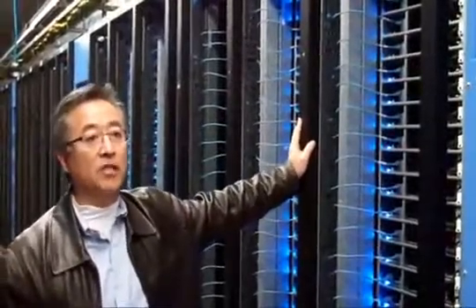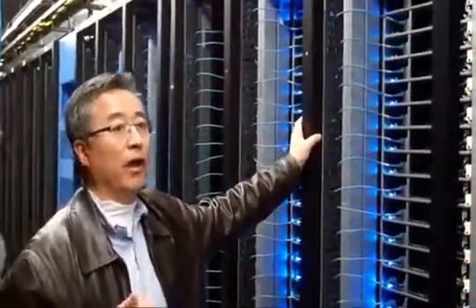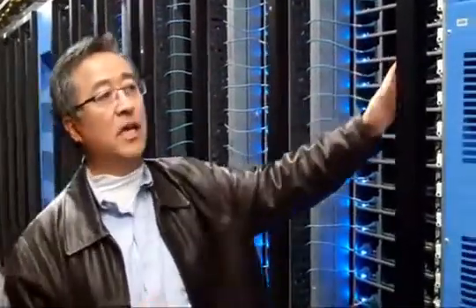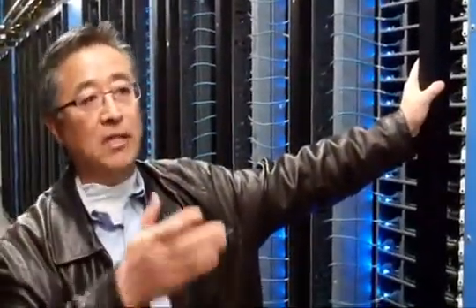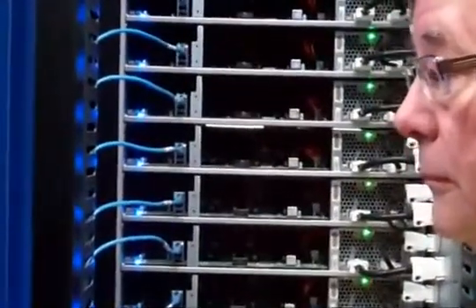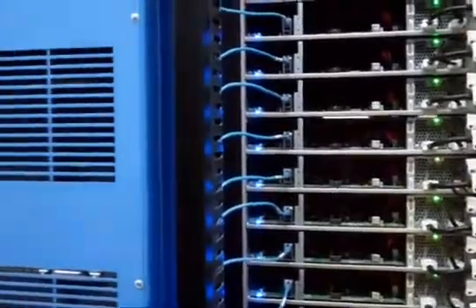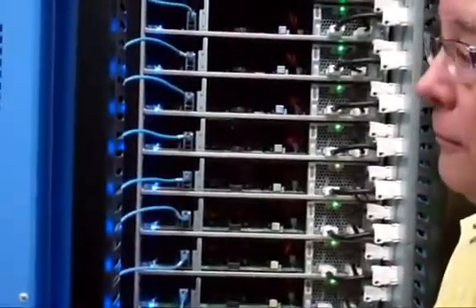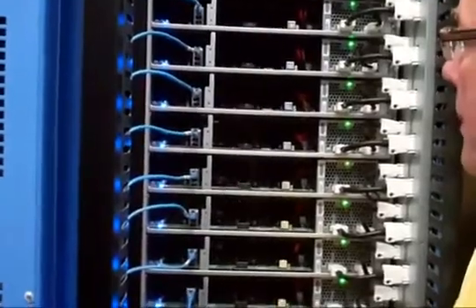What you see here is our custom-made server — it's actually one rack. There are three columns, and each column holds 30 servers. On the right-hand side we have an AC power strip as well as a DC power strip. The DC power strip is only used in case we lose utility power, then DC power gets supplied into the data center. This power supply runs at 277 volt AC with about 94.5% efficiency — very high. Everything is front access: the power cables, the network cable — once you disconnect those cables, the tray just comes out without using any tools.